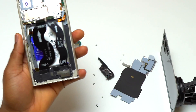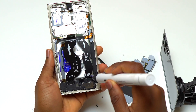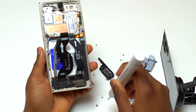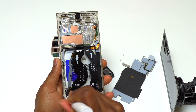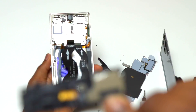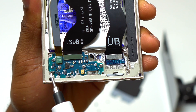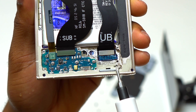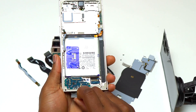If the front speaker had some water, the bottom speaker must be full of water. The bottom speaker is larger and is designed to do the same thing — take some water and hold it from passing beyond the point it can reach, which is the charging module. I removed the loudspeaker and I can already see some water on the inside. Taking a look at the bottom of the device where we have the charging module, I can see water everywhere on that area — the charging module is full of water, with water on the surface and possibly on the back as well.